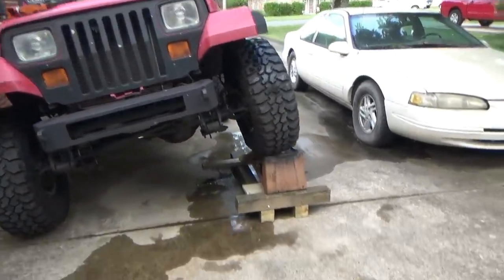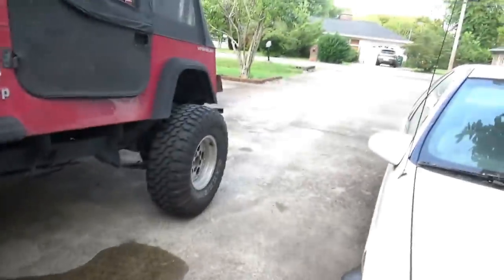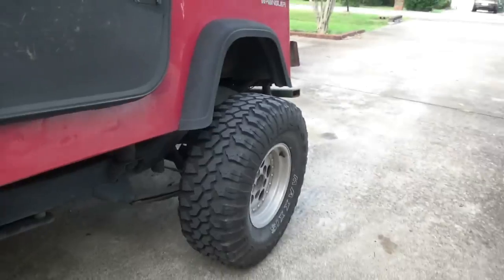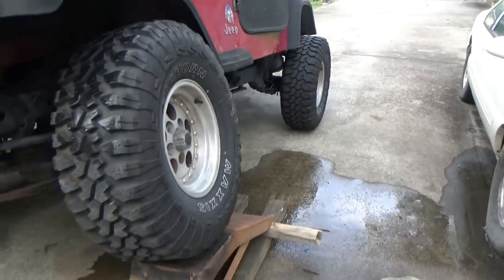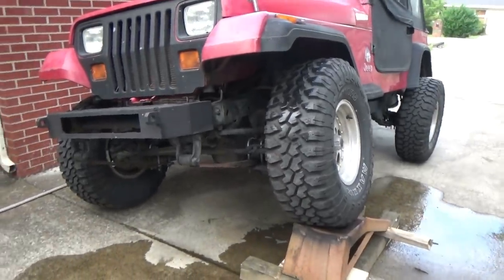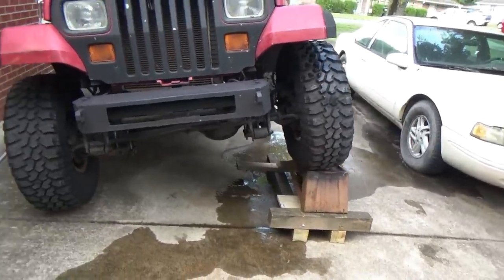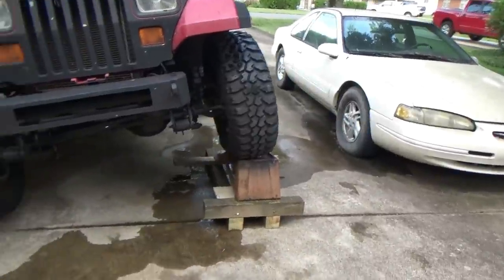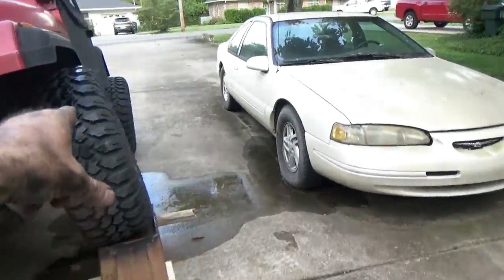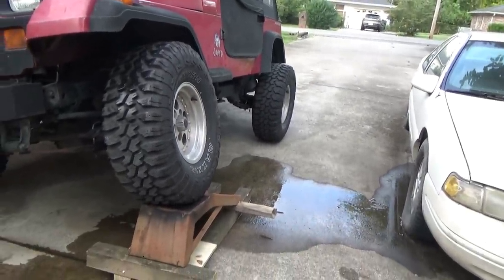Well, I put the ramp on top of the 4x4 there, and I pulled up it, no problem. Didn't bark the tire, no tire squeal back here, didn't spin. I mean, it pulled right up, no problem. Before, when the track bars were on it, I couldn't do it. I was taking all the weight off the back end here, and it was actually the front axle, because of no articulation up front, obviously the track bar was limiting it, that it would actually pick the front tire up at this level. Because I tried that first, and I couldn't pull it off because it would pick the whole front tire up over here, or the back tire was leaving the ground there. Either way, I wasn't getting up it. So no track bars, I did gain flex.